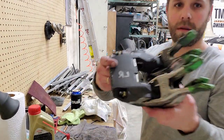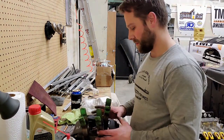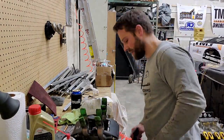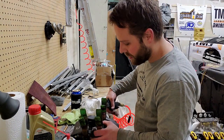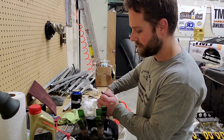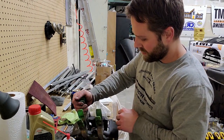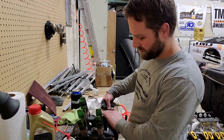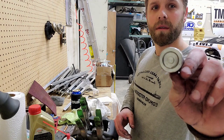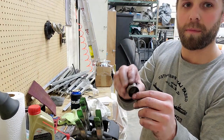So we've got our last caliper, the left rear one. We're going to get these pistons out. They all use the same fluid, so the cavity that's fluid-filled pushes out all the pistons the same amount. What I do is clamp three of the pistons in and then take a little blowgun on the brake line fitting and gently apply air — they can come shooting out of there. I slid them back in slightly. If I do that on all four they're pretty easy to get out in the end. You can see where the gasket in the cylinder bore kind of rests — we'll clean that off with a little emery cloth as long as there's no bad edge.